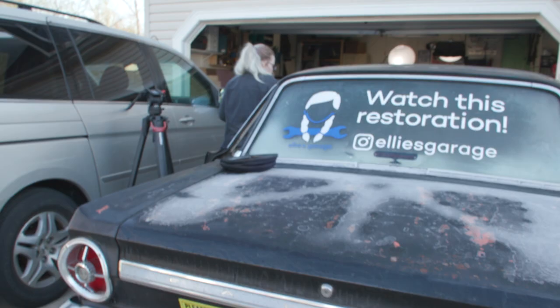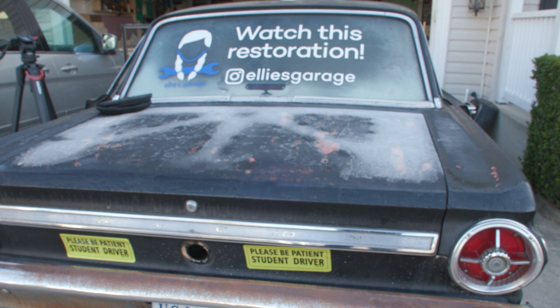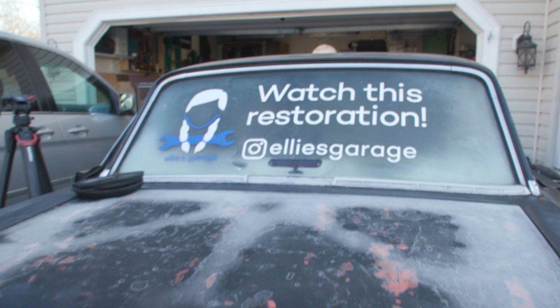That looks pretty good. Now just to plug it in. Why don't you go press your brake and let's see if we can see - even without the car on it should work. It popped on and then went off. We may not have the best ground connection. So it's been a few days and we're coming back to actually finish this project. The brake light - we got it in and it worked for a second and then it just stopped working. We are going to take it out and try to figure out what the problem is. We think it's just the grounding, so we're probably just going to add a piece of metal underneath.